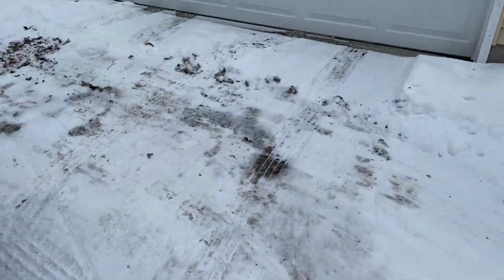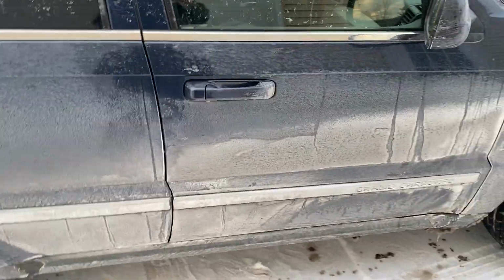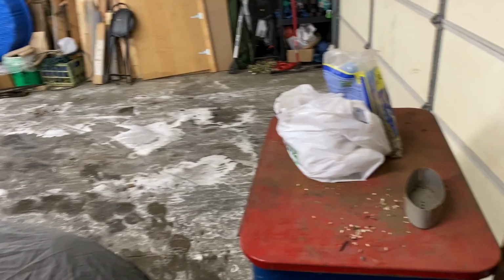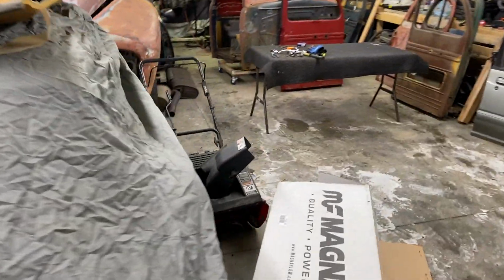Go back in here, and again, yeah, this Jeep ended up melting my wiring harness because the exhaust got a hole in it underneath the floorboard, and the heat of the exhaust was going straight up into my floorboards and into my wiring harness and melted my wiring harness.